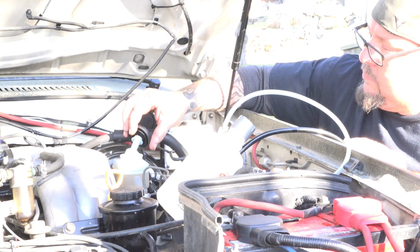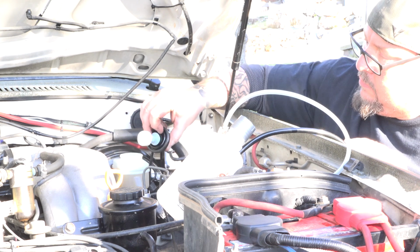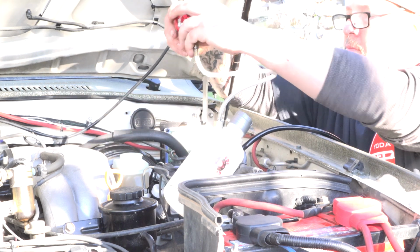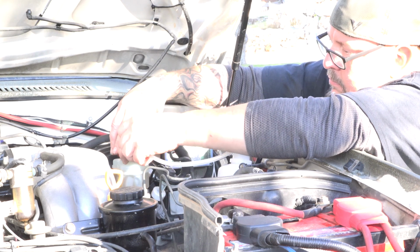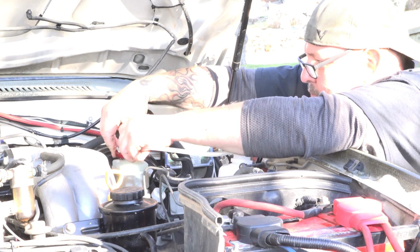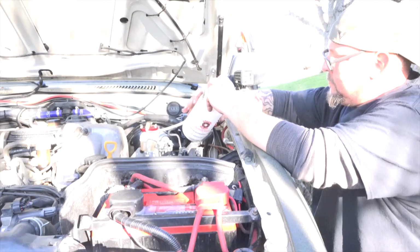First thing is throw on a pair of gloves. Brake fluid is highly corrosive, and try not to spill it under the hood. Pull your master cylinder cap off. Take the Speedy Bleed aluminum cap with the O-ring, gently press it in. It'll pop right in. And then set the 3 wing nuts and make sure it's secure.